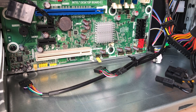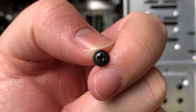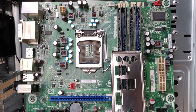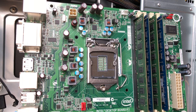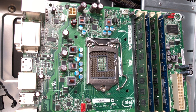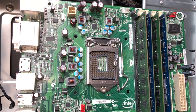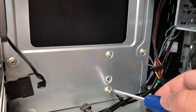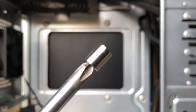Next up, there should be between six and nine motherboard screws to remove. Make sure to put these safely aside as the new motherboard can go in the case on the same standoffs. The old LGA 1156 board is still one I'll keep for other ventures, but I'll be investing in a better cooler to keep the i7 at a better temperature — a beefy be quiet air cooler would probably do the trick. For now, let's get the new board in. It's important to make sure the standoffs line up with the new motherboard mounting holes, and if they don't, a super cheap tool is perfect for undoing and relocating them.